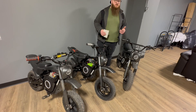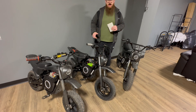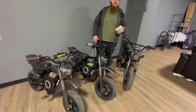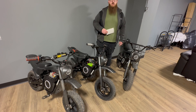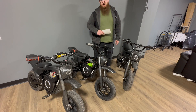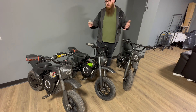As far as top speed, we normally get about 32 mph out of the stock Burromax. We got 37 mph out of the Far Driver powered bike. We didn't get a confirmed number on the Kelly — the Draggy app doesn't really do top speed, so we were doing this based on GPS on the phone. Overall we picked up about 5 mph. The stock controller might be limited to 32 mph to not overspeed the motor — the Burromax guys can maybe chime in on that in the comments.